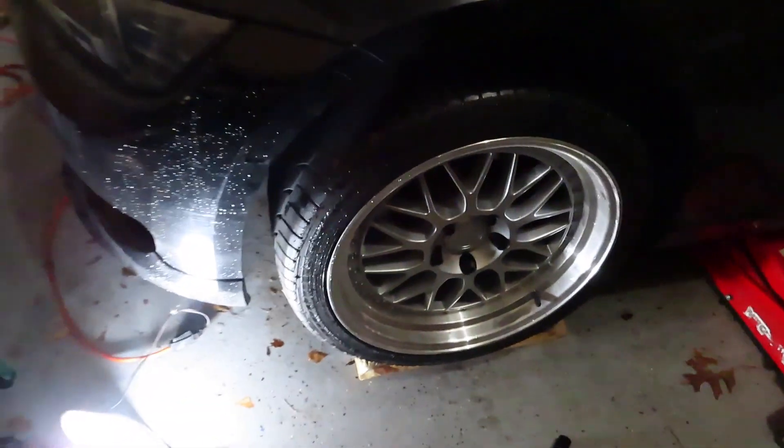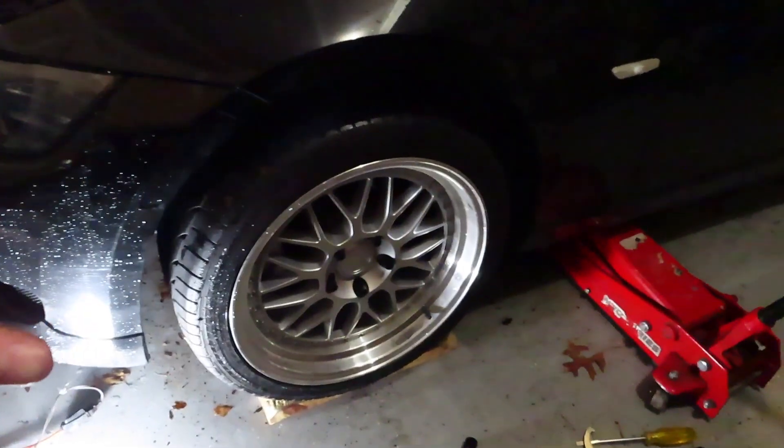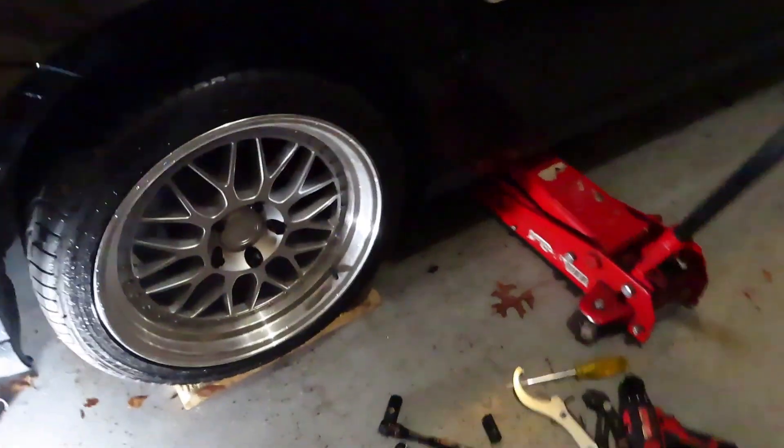Alright, so here's the final test. I got it all tightened up, camber plates on. I haven't done that side yet but this side is done. Looks like it's going to tuck it perfectly. I can't really tell from the side angle, but I'm really hoping that's going to tuck it in there enough. Definitely got some room to go lower if I want, but I might keep it there for now just to see if it rubs. If I don't have any rubbing issues, I might drop it maybe a couple turns.